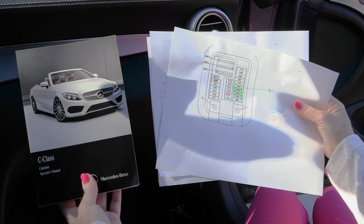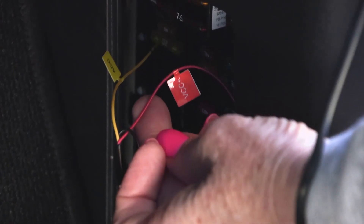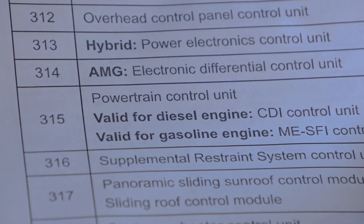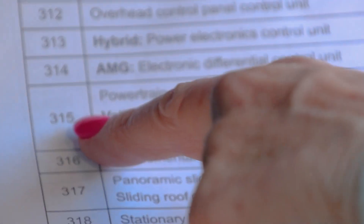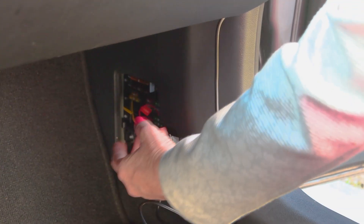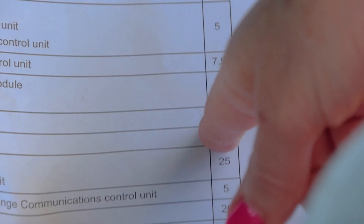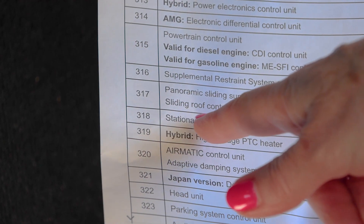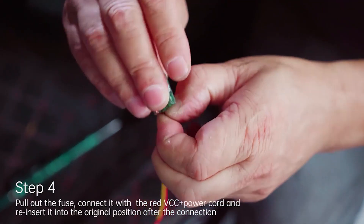Now it's time to hook it up to the fuse box. I grabbed my car's manual and it had the information, but I also printed it out enlarged on my computer to get all the specific information so it's easier to read. I hooked up the red wire, which is the VCC wire, first. I wanted a 30-amp fuse and found that the powertrain control unit number 315 was the easiest for me to use. For my yellow wire I hooked it up to a 20-amp fuse which was number 318 — a stationary heater control unit. Here is a video from the manufacturer of how you wrap the wire around your fuses and how to insert it.